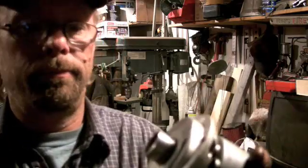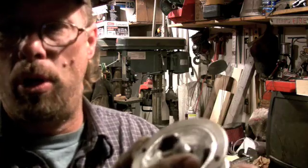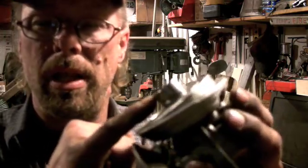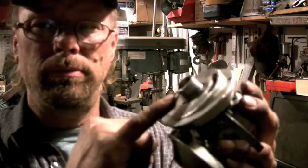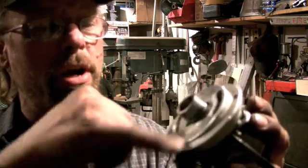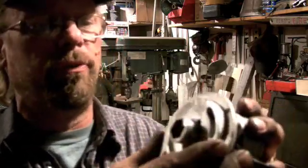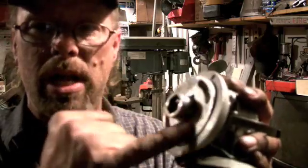But what I've got in this Kia is a dual cam system, and it's got a nut that holds the timing belt pulleys on. So what I did is I took a socket and cut her down, nipped it off the back, took the shaft and machined it square after I had cut it down from the original Volkswagen. Then I put this disc on the end.